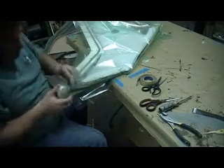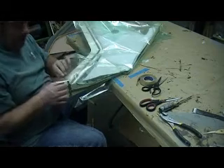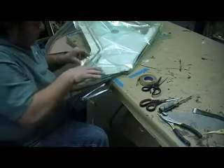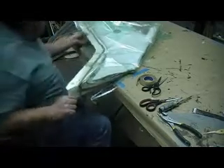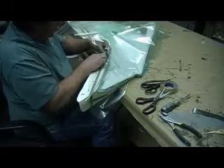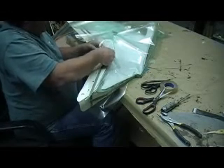Here's how you do this pleat — just stick that in your tacky tape and roll it up there. See right here at the top: you got to be careful not to leave a place for the air to come out. So even if you fold your tacky tape in half a little bit, that's okay — that's what I do a lot of times. These pleats are a place where you can adjust your plastic. We just got to put a bunch of pleats in there to make up all of that. It really don't matter where you put them, as long as your plastic lays down and you use up all that extra excess plastic. Ain't nothing worse than not having enough.